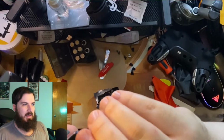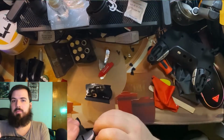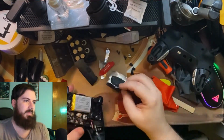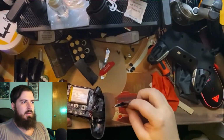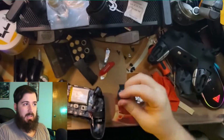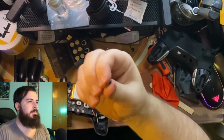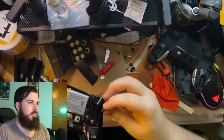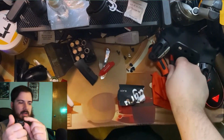You want it to be about as thick, otherwise it's not going to catch when it comes up. There's a little lip right in here that the nub has to catch on. You put the Sugru in there, and it keeps it down a little bit. Now we're past that. There's a little square gap in here. It's hard to see, but you just shove the Sugru right in there, and it's going to prevent this from going down any further.